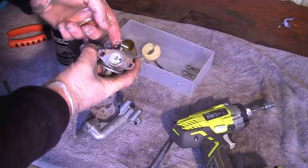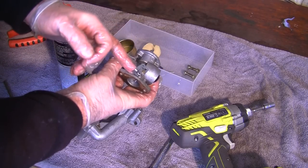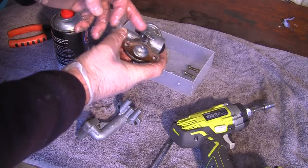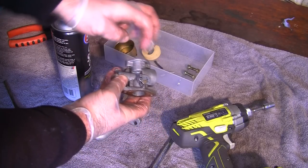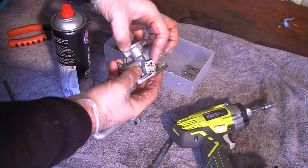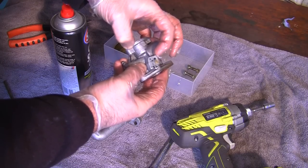One thing to make sure of with this little device here as well, make sure this opens as well. If you have an SV150, sorry, don't mean to swear, I hate these SV150 engines. If you have an SV150 Mountfield one and you've tried everything, you still can't get it to stop revving up and down, this little spring here, if you take the actual carb apart, if you can be bothered, you'll find a lot of them break on the SV150s, and this actually doesn't do its job.